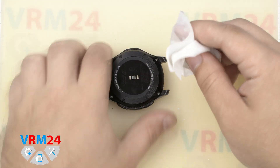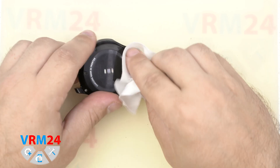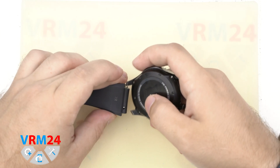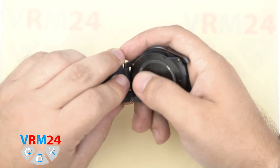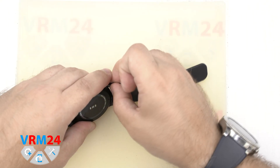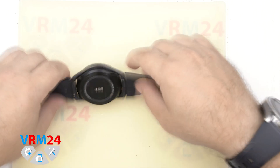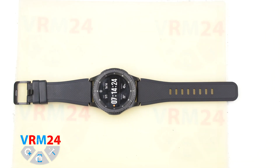Using the 3-wing 2.0 mm screwdriver (Y20), we screw in four screws to fasten the back cover. After assembly, we moisten a small cloth with isopropyl alcohol and remove the remaining sealant. We attach the strap to the smartwatch. This is the end of the battery replacement. Thank you for watching — if you've watched up to this point, don't forget to subscribe. We will post battery test results on our Instagram, so check it too. Take care of yourself and see you in the next video.